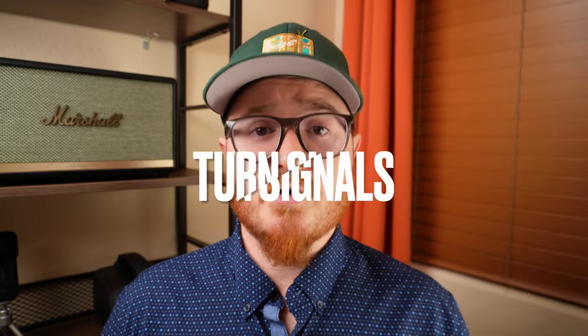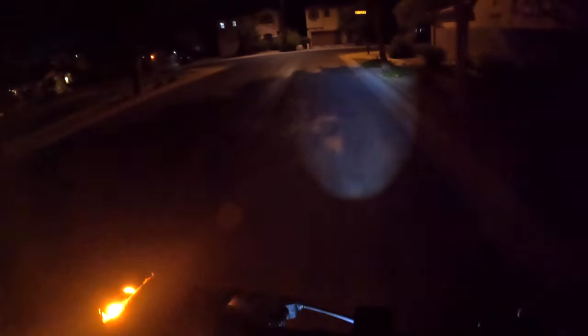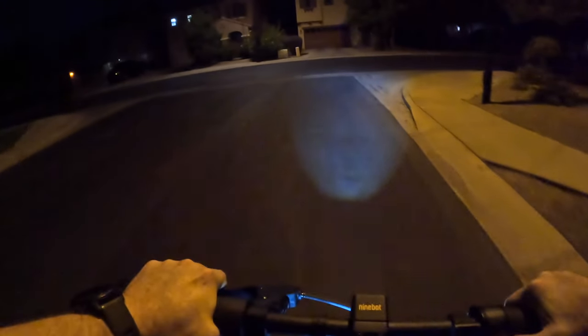The next thing to improve is the turn signals. Segway has done a great job mounting those signals high on the handlebars for visibility, but I wish they had gone with end-cap style turn signals. With a wider grip on the scooter, I find it very easy to cover those turn signals with my hands, making them invisible to everyone around me. End-cap style would solve that, though the downside is they can break if you drop the scooter. I'd also like to see turn signals in the back of the scooter, since wider shoulders or a backpack could block the front ones from riders behind you.